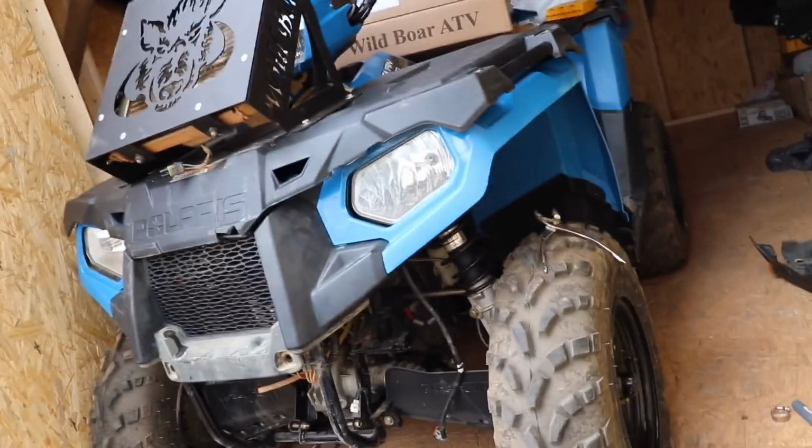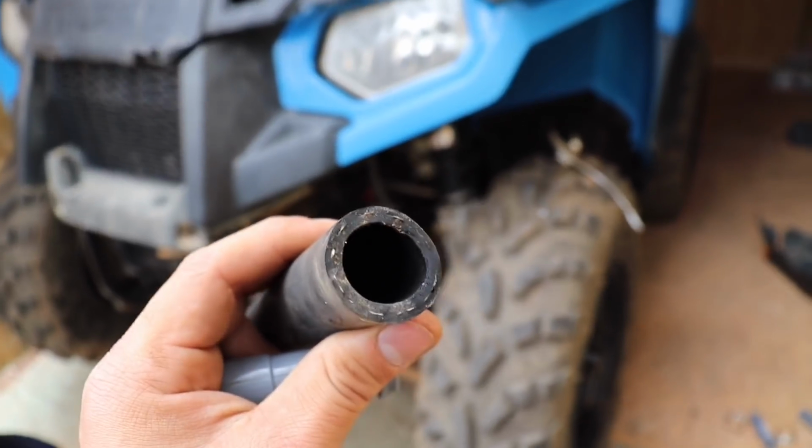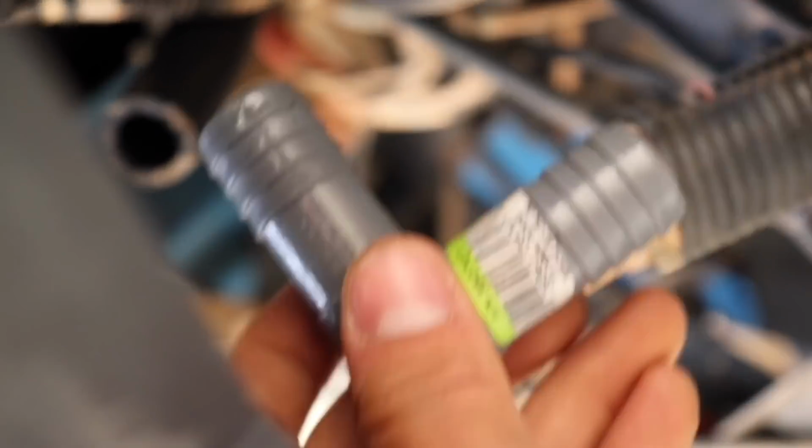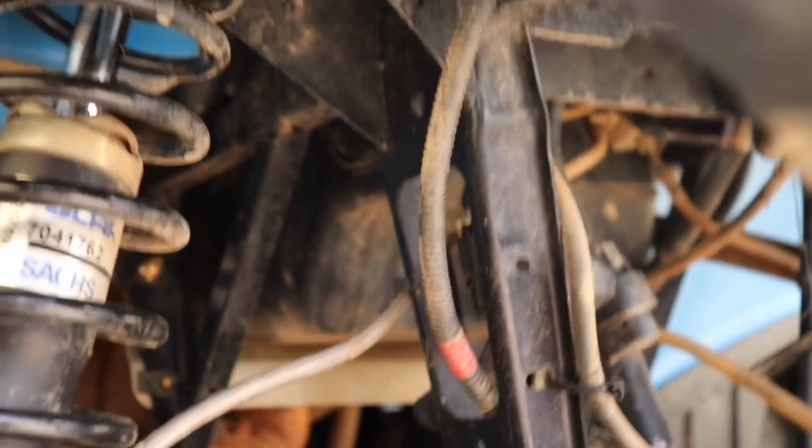All right, guys, so whatever kit you buy, it should come with a hose like this to run your coolant pipes. I think this is 3/8 of an inch or an inch, probably a little smaller. But it also comes with these adapters, which is the 90, then it has 2 little other smaller ones. So for this one, we have this one ran already. Well, actually it's up here. We have it ran, it's right there. We're gonna put the 90 onto that one and then put it onto this one, and then this side's gonna be done, and then that hose is gonna come over to this side, which is just gonna be ran to this right here, ran through the back, brought down, and connected to this one. And for this one, we'll just use one of the little extenders, but I'll show you what it looks like after so you get an idea.